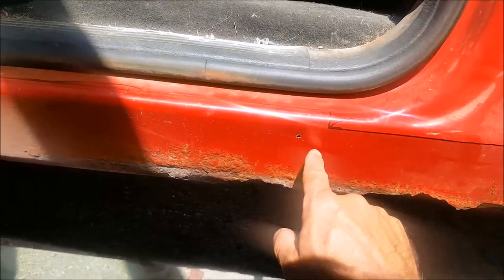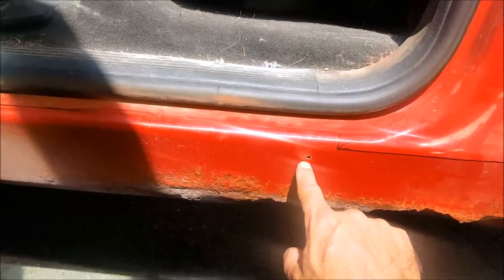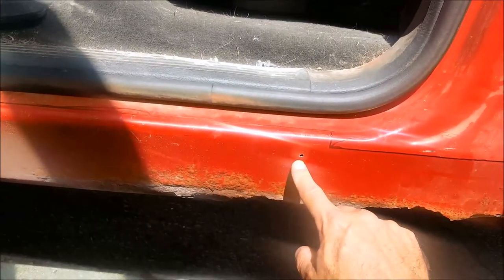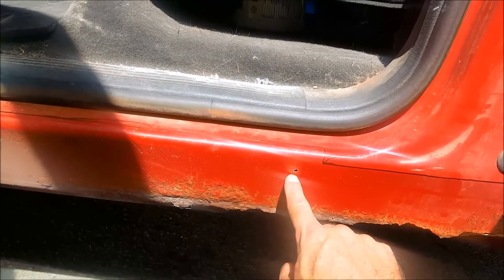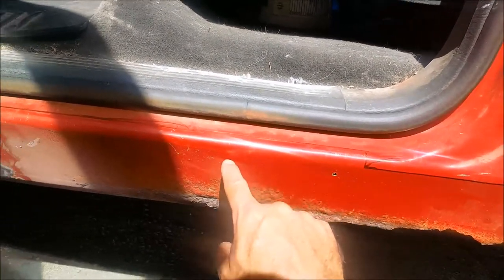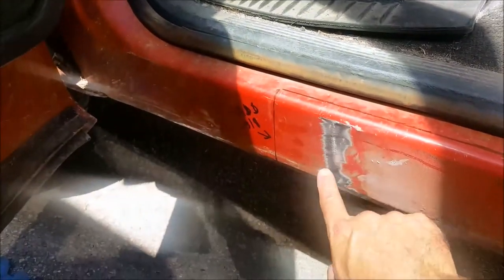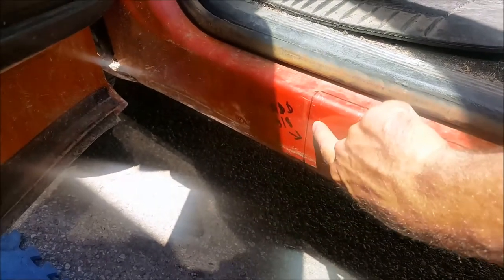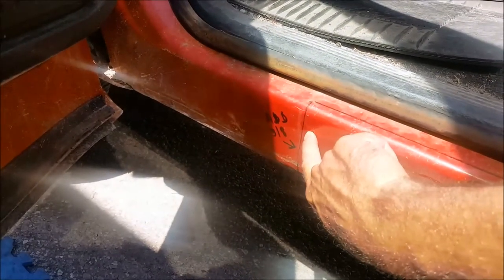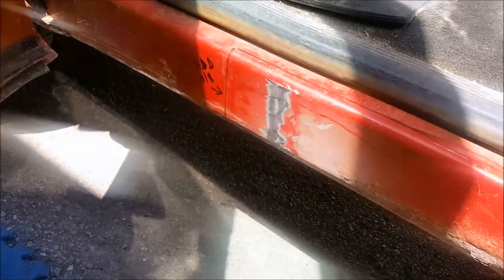I'm going to cut and relieve about three eighths, maybe half inch along here. This is probably the worst area right here — good metal in here, no problem. I'm going to come across, leave my screw hole, keep going just under the door, maybe an inch under there, and pass on by. Get rid of all this along here. There's no point cutting away good metal — this is going to lap and weld in around what is still here. That's what this type of panel is designed to do. Cut back, measure three eighths of an inch, about maybe a quarter, and cut that away.